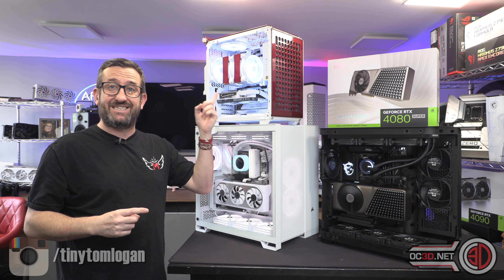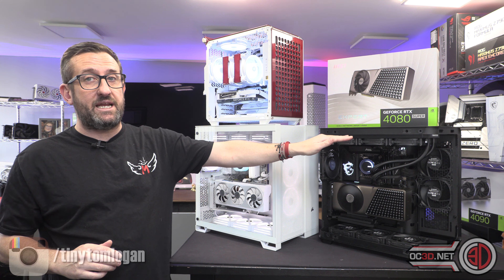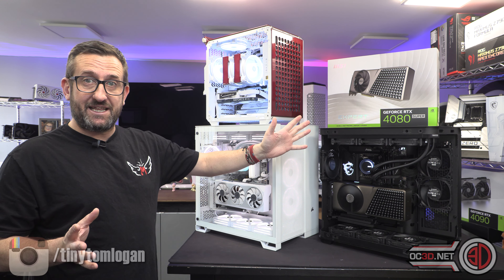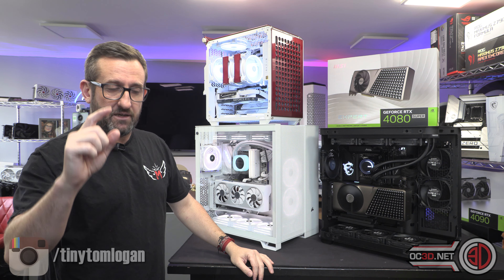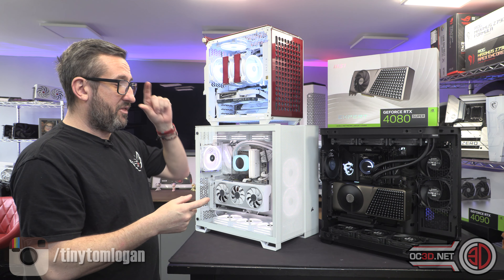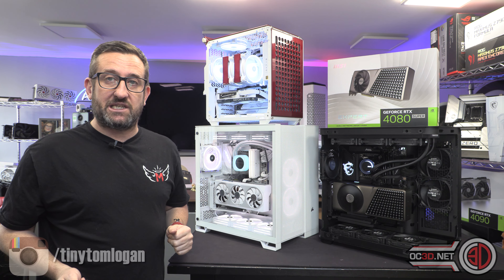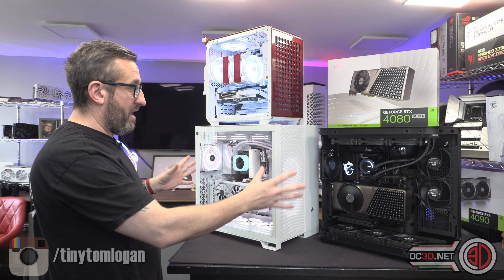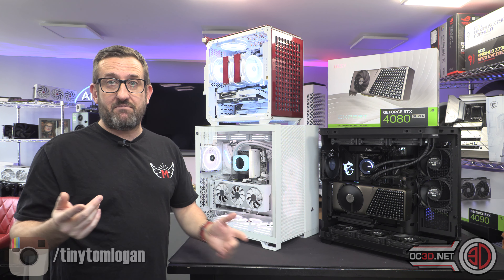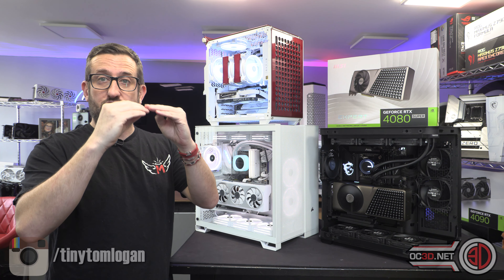The Asus one with the i7 is the difficult one because it's an air cooler, but even with the 360mm AIOs on the 14900K they all throttled — they all hit 100 degrees. What we did at the end was brought the temps down by at least 10 degrees but put the performance up. It's basically the way I think Intel should have done it from the start, because 1.4-plus volts on a 14900K is just too much. All the brands went with the normal Intel voltage tables, and on Cinebench 24 they all hit 100 degrees and the clock speeds dropped accordingly.